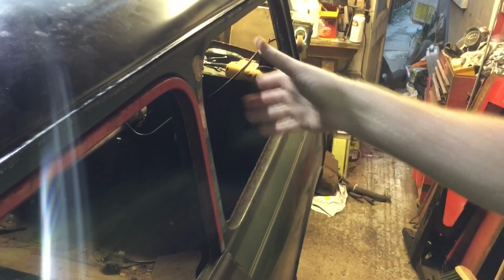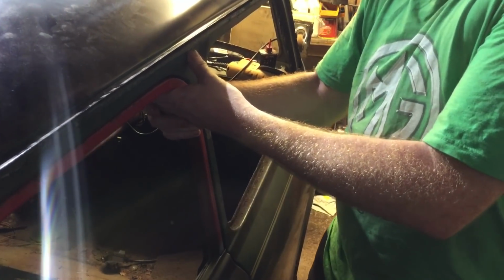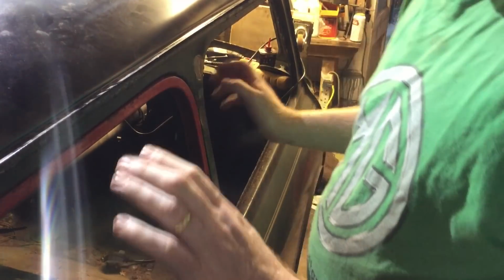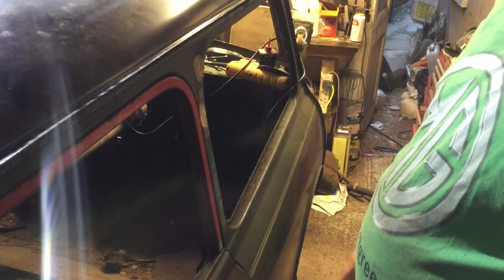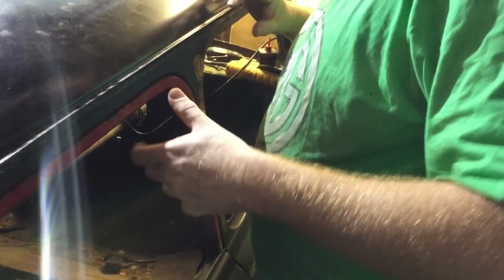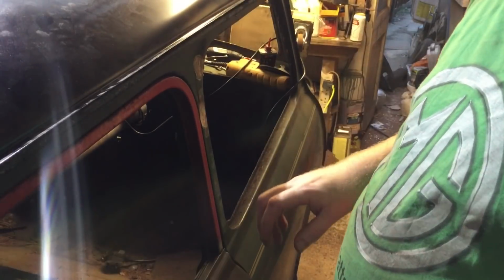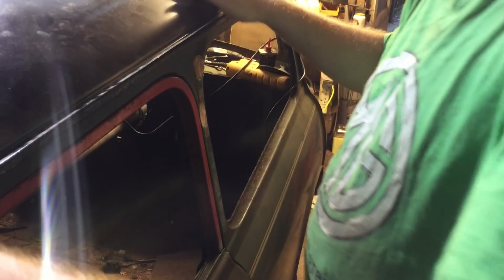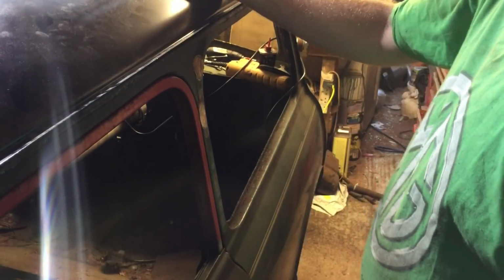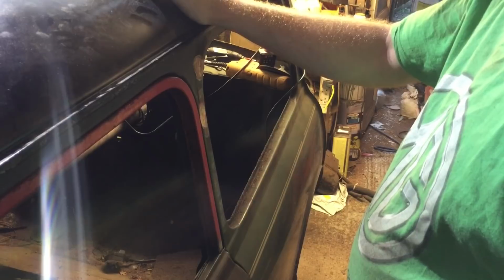But again, it happens on the side of the car as well. Now we've removed this, you can basically pull the side of the car apart, and we might even have to put a little jack in it, not permanently, but just to give you a bit of space. So I think that's what it's going to do, and the whole thing will then drop inside. Once you get it inside, it will ping out like a drum, and then we can clamp it down, it'll be fine. But it's a case of trying to force this thing the best we can without distorting it, because what you don't want to do is push so hard on this that you put a dent in it, because at the moment it's pretty much dent free. So the last thing you want to do is put a palm print in it.